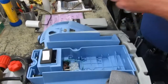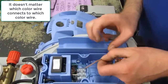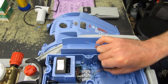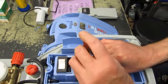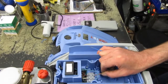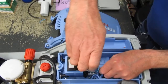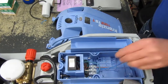Take the new one. I usually match the brown wire with the brown lead on the other side. It doesn't matter which one goes where, because it's the only capacitor for the starter for the electric motor itself. Gently push it in — you can feel it. Turn it clockwise. Give it a little tug; you know you're in there. Do the same to the left side. Push it in, turn clockwise, give it a little tug. You're done.